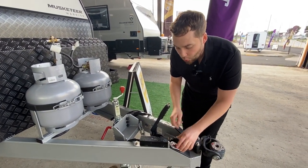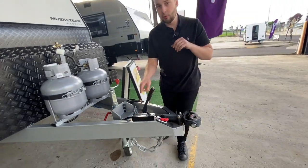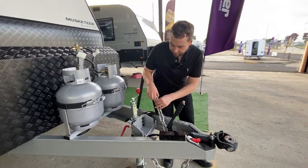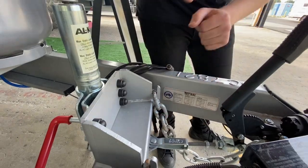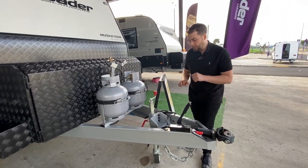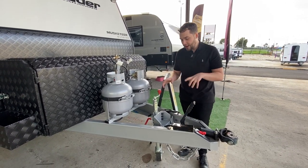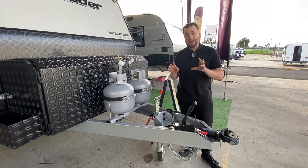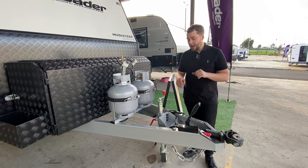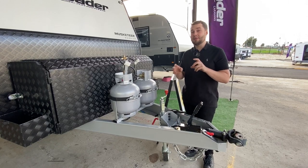You've got the breakaway no-battery system with the trailer brake system. This is wired directly to your caravan batteries — no maintenance, don't have to check on it. We've got these Crusader Intel chain-hanging systems at the front. Massive plate, Alco 400-kilo-rated jockey wheel. 90% of the hardware we're running is an Alco product with the Intel chassis. It is a 3mm steel chassis, Australian-made with Australian-sourced steel.